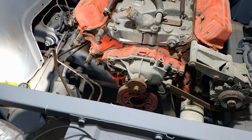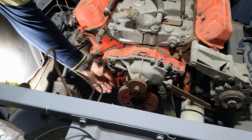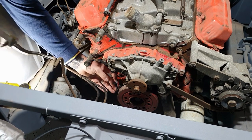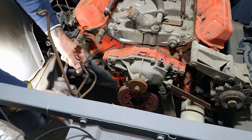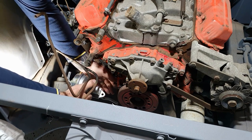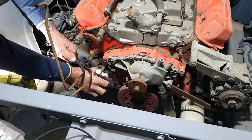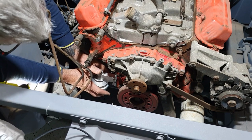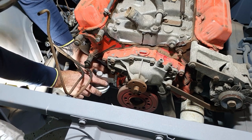We'll put on the gasket - it came with two gaskets in the kit, I'm just putting both on for the benefit of this process. Get the fuel pump in there, get these lines out of the way. You should feel some sort of resistance on it when you're bolting it in. You can see that the pump is pushing back out under its own force - that pushing-back-out process is the spring tension of the pump on the diaphragm.